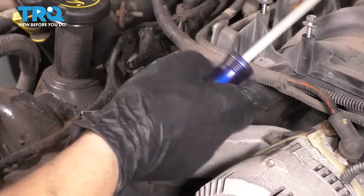Looks like we have some slack here, so I want to check the tooth on the bottom, because there's too much tension here, too much slack here. I don't like it, and I think it jumped a tooth. Okay, well, it didn't. So what that means is once tension is being applied here, it's going to turn this cam counterclockwise, which, looking at it right now, is supposed to be at the 12 o'clock position. It's kind of towards 12:30, closer to the 1 o'clock position. So that makes sense as to why it has slack on the bottom, because naturally the springs want to push it that way, but it needs to come back like this. And then you can see we have tension here and slack here. So that's actually perfect. I'm not going to touch this anymore.